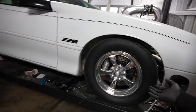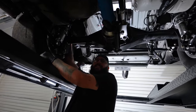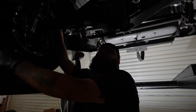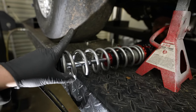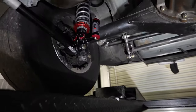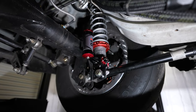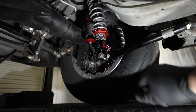We're sitting a little low but we can adjust it and bring it up. We kind of went with where we were out and forward to see where it ended up, but with the shock it sets a little different now. Now it's on the back. Time to knock it back - this should be super easy. Not wasting any time getting these bad units out. This will be way easier than the front. By the time you guys see us again one will be out and the other one will probably be going in. Now we got the rears ready going - this is the coil over conversion on the F body. Got the spring set up, the spring is actually the same weight that we had in the car. These are the piggybacks - they'll go to the inboard of the control arms. We did run into a little bit of a snag where it wanted to rub this bracket, but we did a little weight reduction to the mount. The piggyback just sits right here in this little pocket and then we'll be able to just reach up in here and make our fine adjustments.